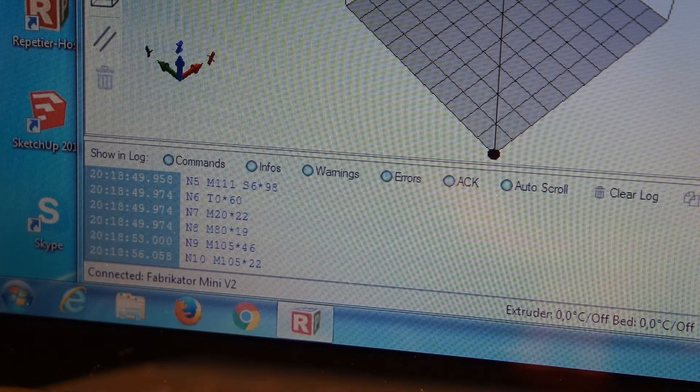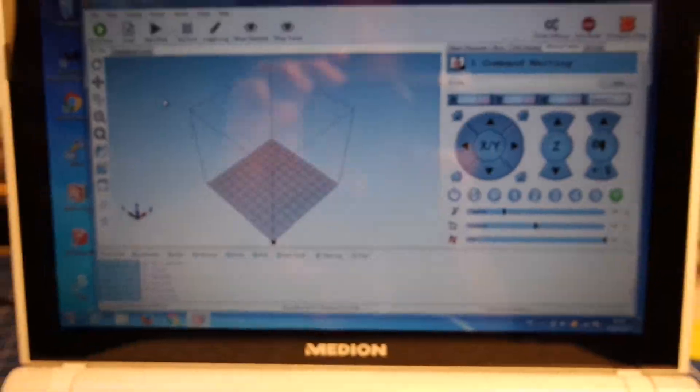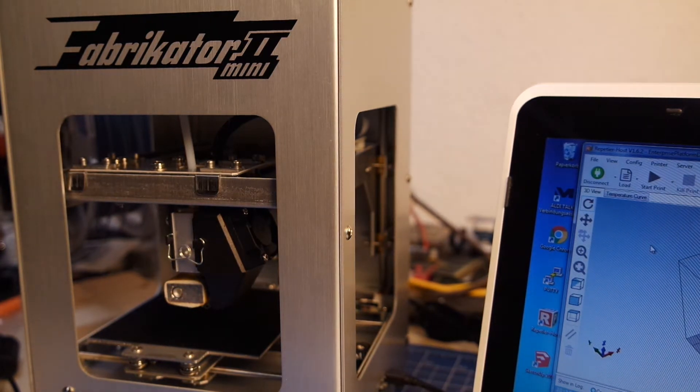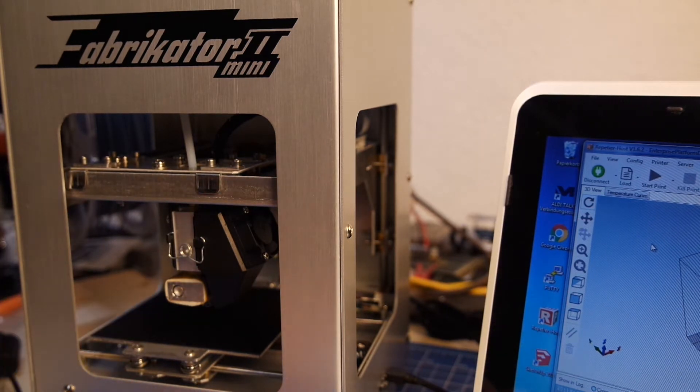Basically, that's the whole difficult part of it — there's nothing difficult at all about it. You just have to get it right. In my case, the problem was that I clicked Finish and not Connect, so it didn't actually transfer all the information to the printer. It never knew what it was supposed to connect to, and since it doesn't span a network of its own, I never found it in any scans — it just stayed hidden. So if you want to set up Wi-Fi, just make sure you take the right route and follow all the steps.